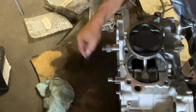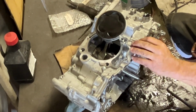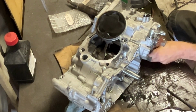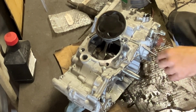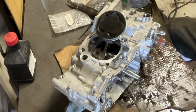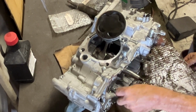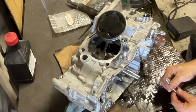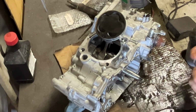That is the shift rod and shift ball. That goes through the motor and the input shaft. That's what opens and closes your clutch. That is directional. The big end goes in last. Little end in the shaft first. Ball, and then the plunger for the clutch basket itself. If you forget either of those parts, your clutch isn't going to work.